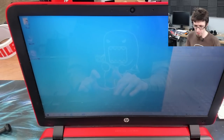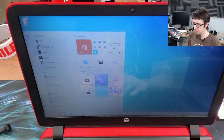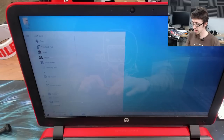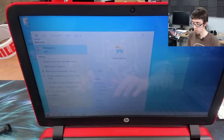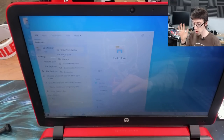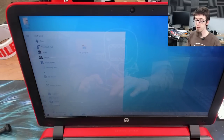Then in the notifications, for some reason or other, we're in alarms only. So I'm just going to switch off Focus Assist there. I'll clear those and collapse that. There we go. That'll do. And now finally, on the Start menu, I'm going to clear these stock icons, and then I'm going to click off the start menu and click on it again and then type in file to get File Explorer. The reason why I closed and reopened the start menu is I don't know if they fixed it. However, if you've been changing icons on the start menu, it blocks you from searching.